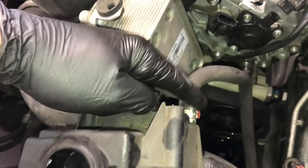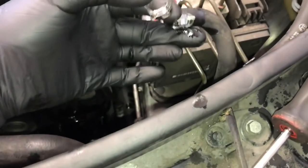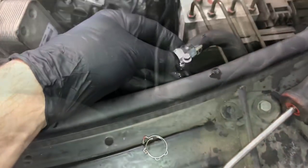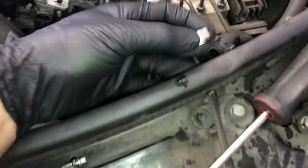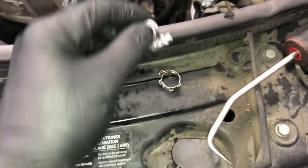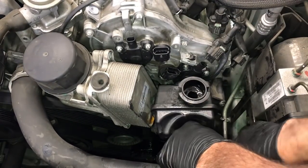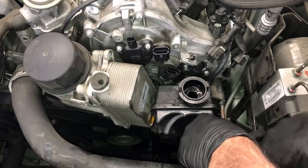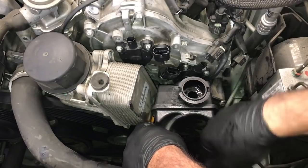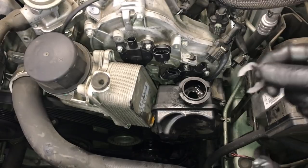Going back on, I found it's easier to remove the return hose now that it's out in the open. Use a 90-degree pick tool to open the little clamp and take the hose off. Instead of reusing the old clamp, I decided to switch over to a German-style hose clamp. Now slide the reservoir back over the pump and into position, start the three fasteners by hand, run them in until snug, and tighten all three down. Now for the tricky part: putting the C-clip back in.